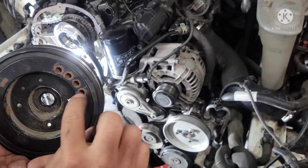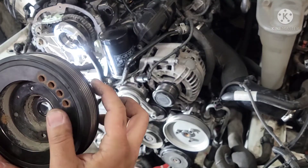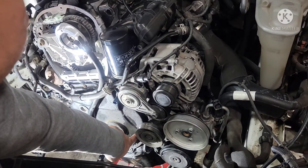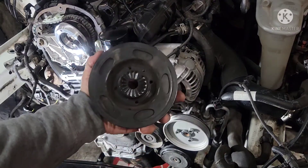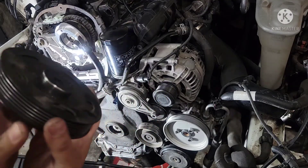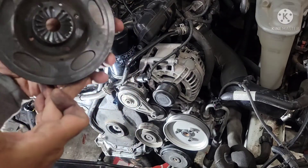There's a little notch right there, and there is a blue line going across it. That notch has to line up with the marking on the timing cover. On the back of this pulley there's a little V-shape notch, so it only goes one way — the 12 o'clock position, like this. 12 o'clock.